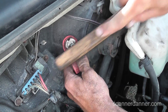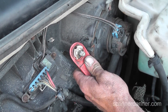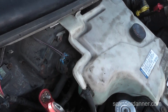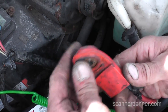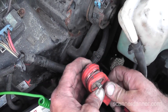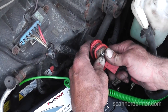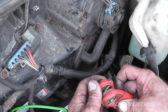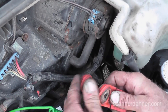Hey, you think that wire brush is big enough for what we're doing, Tim? Yeah, a little bit. Maybe we should probably get a bigger one. Okay, so I want to be clear for those of you watching this procedure: when we poke that small hole in the positive cable, we use liquid electrical tape — it's actually made by Permatex. You can get it at Walmart for like five bucks. We'll put a little bit of that on the hole that we poked. So it's just a lesson on doing voltage drop testing.